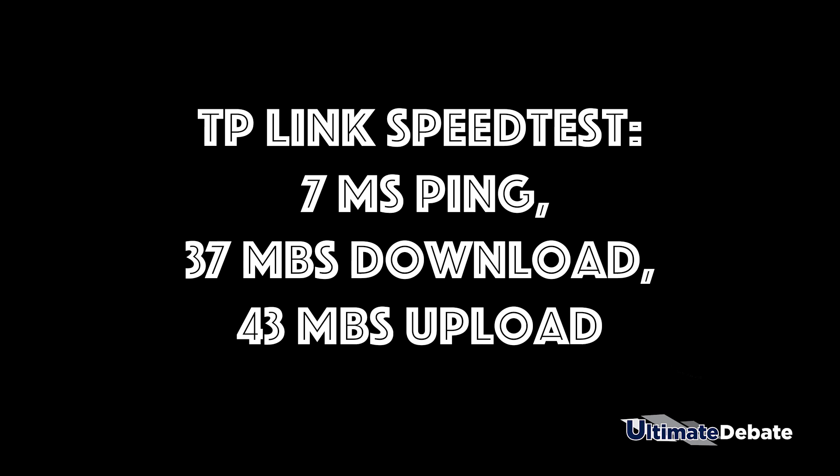For the speed test, it had an average of 7 millisecond ping, a 37 megabit per second download, and a 43 megabit per second upload. Not the best — it is worse than the Rosewill adapter, but not by a long shot. The advantage is it plugs into almost anything: it can work on Mac, Windows, and Linux. So if you have an old Power Mac and you just want to get online for a cheap and affordable option, this is a pretty good way to go, seeing as you can't plug PCIe adapters into laptops, and even some older Macs with PCI slots require a certain brand or model. So this is a good universal way to just get internet back.